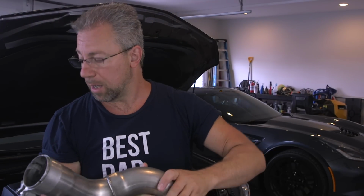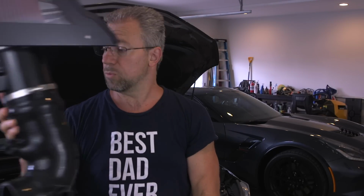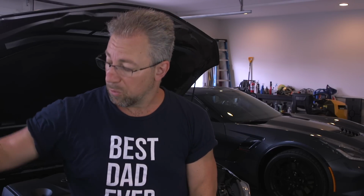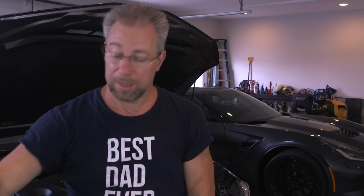It really is. And if you ever want to do modifications for the intake, with my Camaro, I put the air intake in there and took out the stock one, which is really good. The aftermarket one has more air circulating through, more air going in through the throttle body, especially if you get a slightly bigger throttle body to let more air in. That gave more performance as well. In the Corvette, this was the stock air intake system, so it's kind of limited. If you look at the filter, I would show you the other one. Maybe I'll get a chance to show you soon.